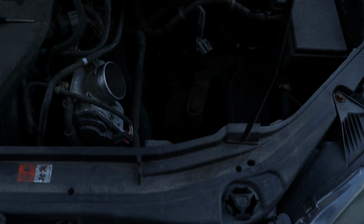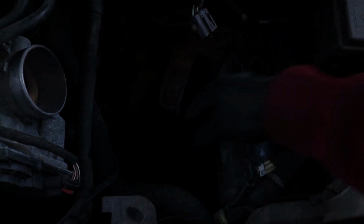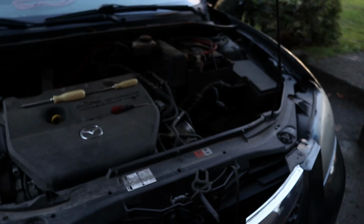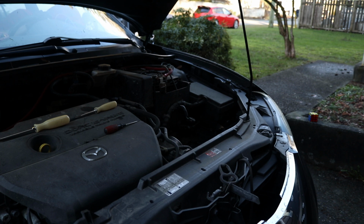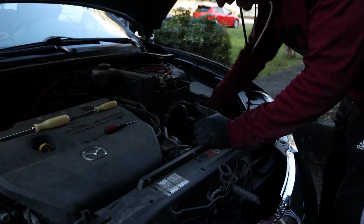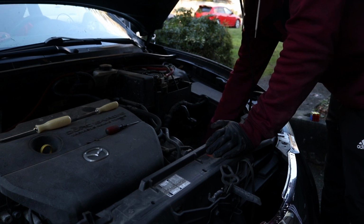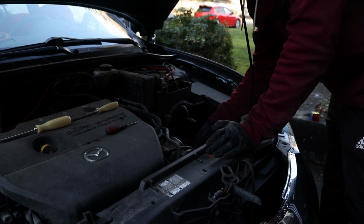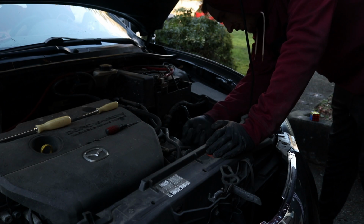You guys won't be able to see in there, but when you take your intake out, you're gonna see an air tube kind of in this location. That is your intake resonator. It basically sits under the front of the fender liner, and it just brings air in because the airflow of the stock intake is quite weak. You can remove this when you take the front of your bumper off, or you can keep it if you want some extra airflow coming in from the bottom. It's out. I'm gonna go ahead and take the time to clean the throttle body because it's super caked.